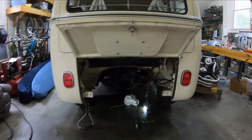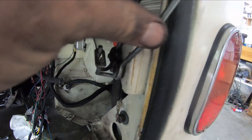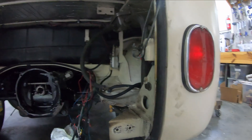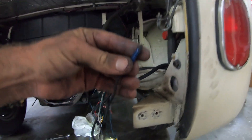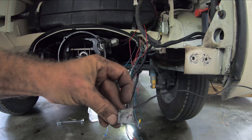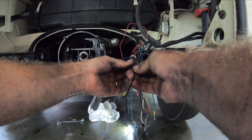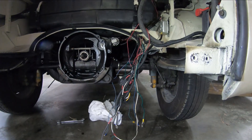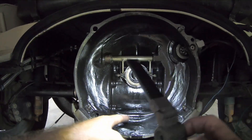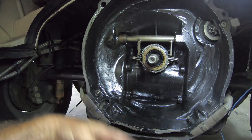One thing that I had broken was this little clip right here — I had popped this thing off and then the deck lid just wouldn't close, but I was able to locate this piece and put it back on. The other thing I did is I knocked off this connector which goes to the plus side of the coil, and it came off this wire, so I'm just going to reconnect that. Starting to look at the problems here — the first thing I see is it's pretty clear that I had a main seal leak because I have oil all over in here.